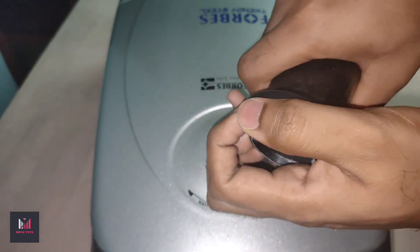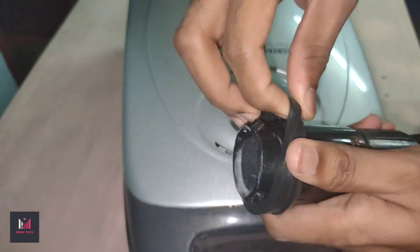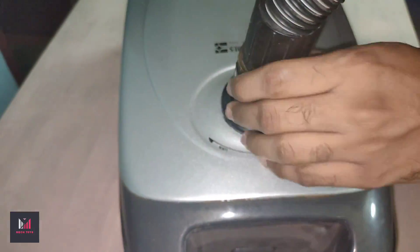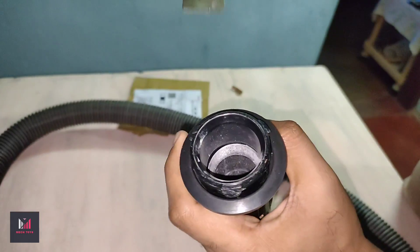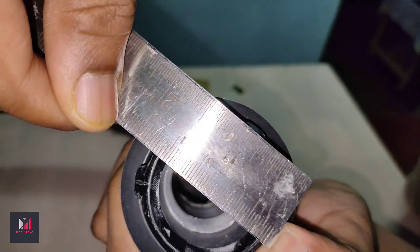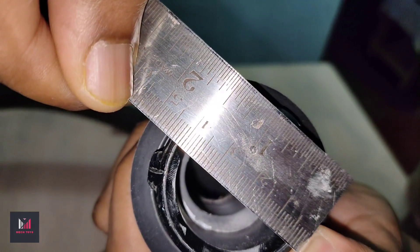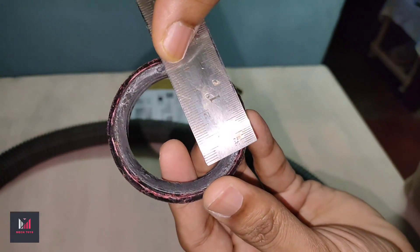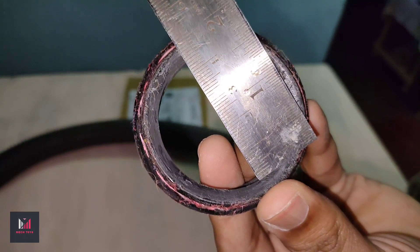It's really hard to remove the old one. I installed the new seal into its place — there are slots given for it. See, that's perfect and tight. Make sure you check your hose diameter before ordering a rubber seal. Mine was 42–43 mm and the seal's inner diameter was 42 mm, so it was perfect. Whereas the old seal was showing 45 mm — it had expanded a lot over the years.